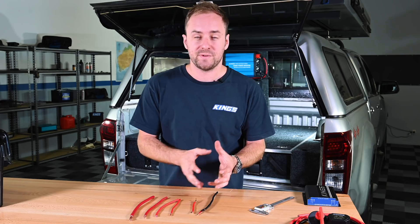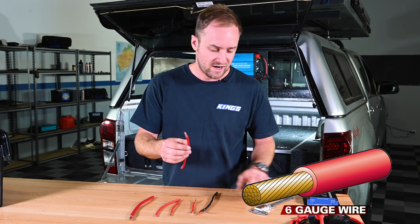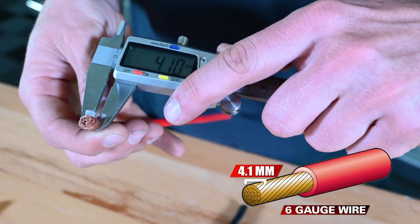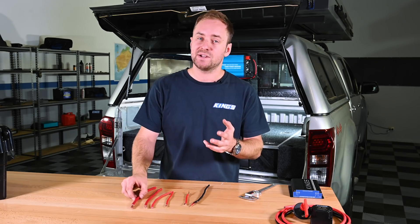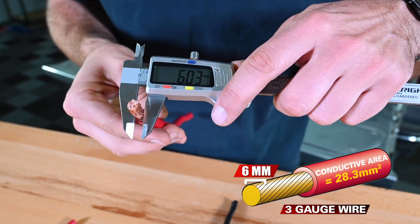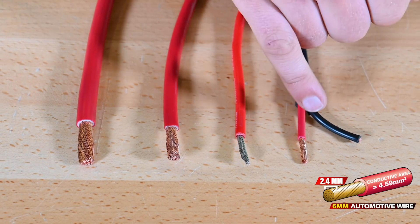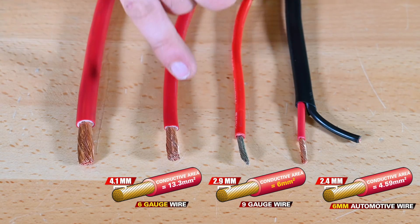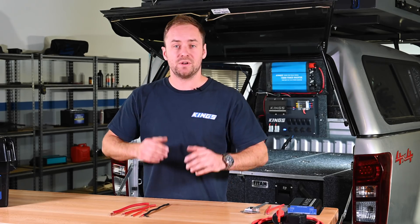You can really easily see the difference between the 6 millimeter cable and the 6 millimeter squared cable. But if your installation calls for 6 gauge cable — 6 AWG or 6 B&S — you'd need to step up to something this size. That gives you about 4.1 millimeters of conductor diameter and about 13.3 square millimeters of area. And finally, if you were using actual 6 millimeter diameter wire, 6 millimeter diameter gives you 3 gauge wire. So this is called 6 millimeter wire, this has an area of 6 square millimeters, this is actually 6 gauge wire, and this has a wire diameter of 6 millimeters. No wonder it can be so confusing.